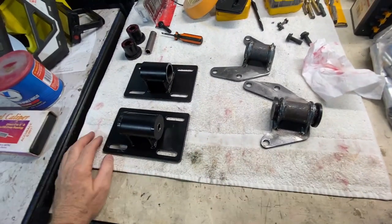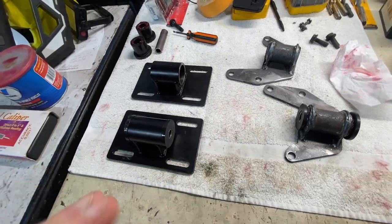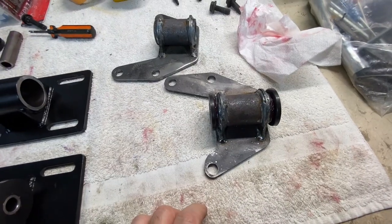Sure, these are cheap, but this is not an area you want to cheap out on. Spend a little extra, go American, get quality-made mounts — once you put the motor in place you don't have to worry about it anymore. With these cheap ones, sooner or later it's going to come back and hurt you, whether in time, money, or damaged equipment. When planning your build, research it first, find what other people are using, and compare a forty or fifty dollar set versus a hundred dollar set. That extra sixty dollars into the foundation of your swap is well worth it. Don't buy crap — thanks for watching.